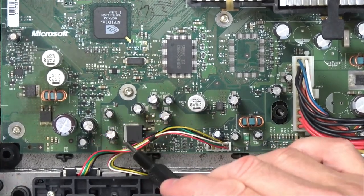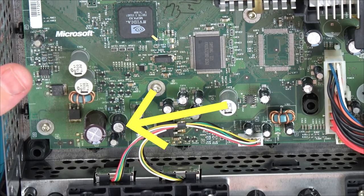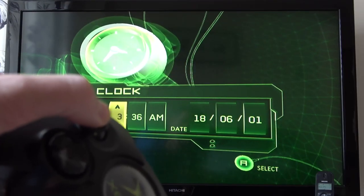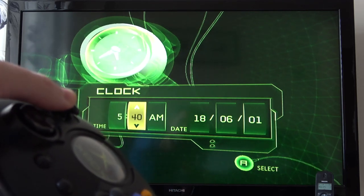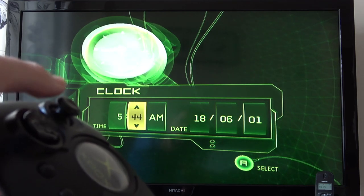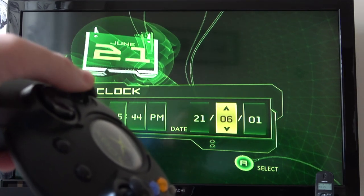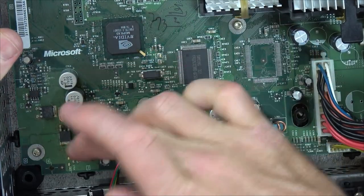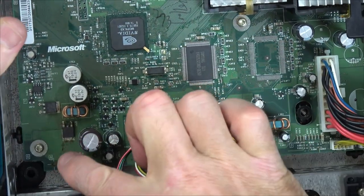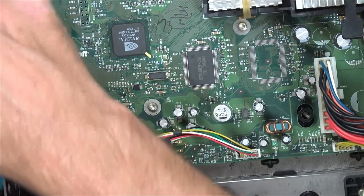That is exactly where the clock capacitor is. Now, if you're not sure what a clock capacitor is, it's a one farad — not microfarad — one farad capacitor, like a supercapacitor acting like a battery. When you unplug the Xbox from AC power, it stores the clock details — your time and date settings — for a few hours, so when you turn it back on you don't have to re-input those details. A lot of people just remove this because they don't use their original Xbox very often. The problem is if you leave it in, it can cause very bad corrosion where the electrolyte leaks out and damages traces on the board, stopping your Xbox from working. You can see the amount of electrolyte that has leaked all around the clock capacitor, and if left it can become corrosive.